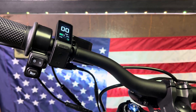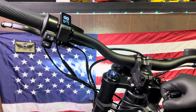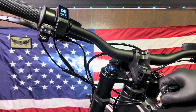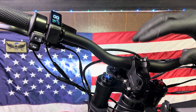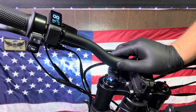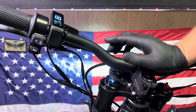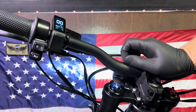You do want the bike up in the air, or at least the rear wheel up in the air. On older bikes you needed to have the kickstand down; on some bikes you needed the kickstand up. So if the calibration fails, just switch whatever position your kickstand was in. On the most modern bikes, as of summer 2024, it doesn't matter what position your kickstand is in.